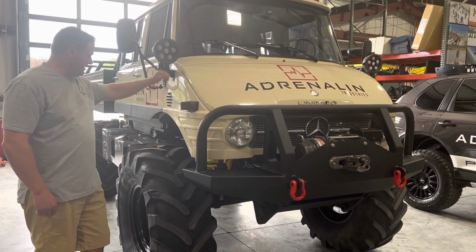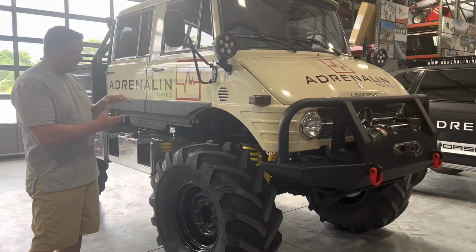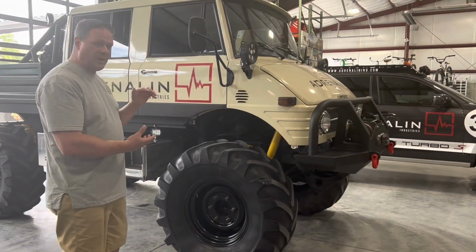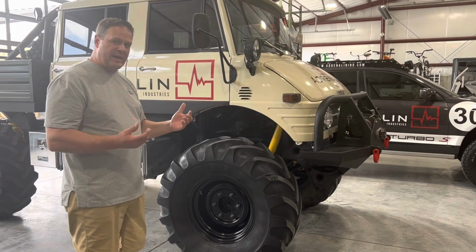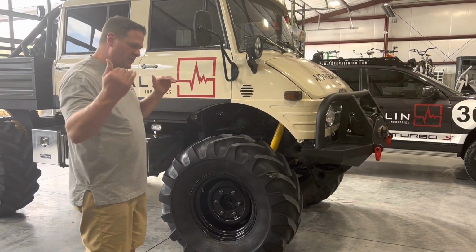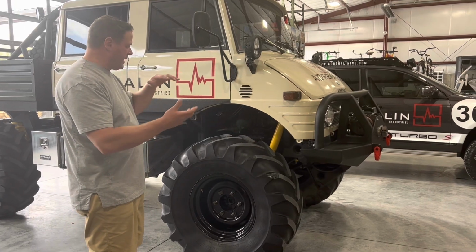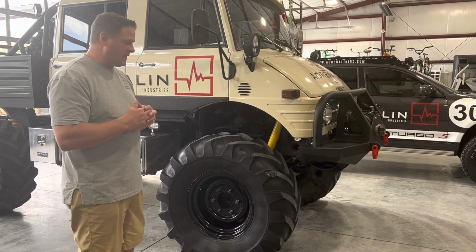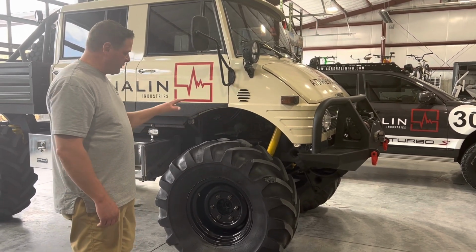It's pretty impressive. When Jay Couch does the waste-gated turbo on these, that turbo requires a 3-inch body lift. And there are numerous benefits to that. One is the cab will run cooler, I think because you have more air traveling between the motor and the cab to blow that through. It also makes the cab quieter. And then it allows you to run the next size bigger tire, which are so much easier to find.